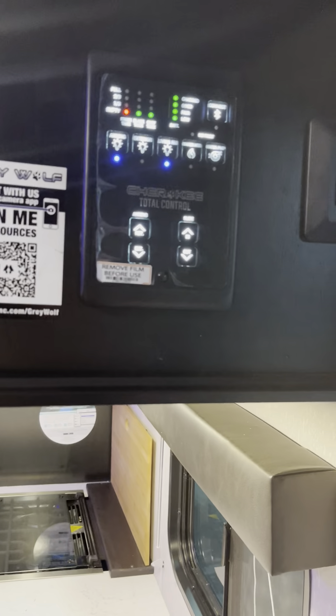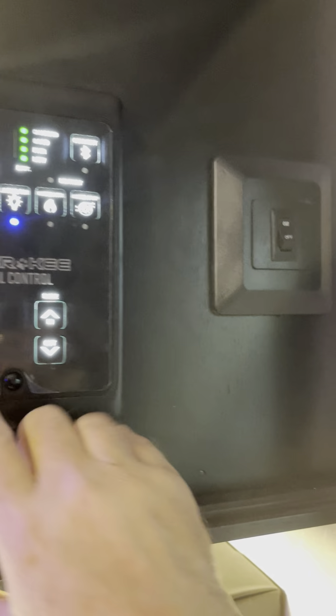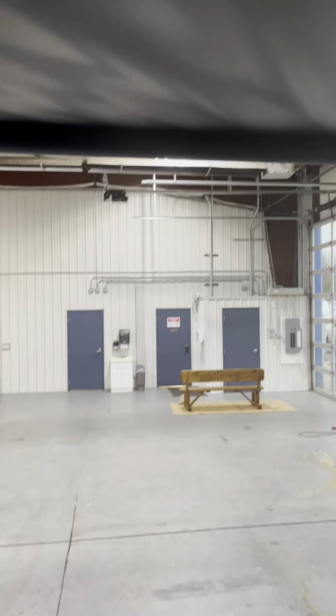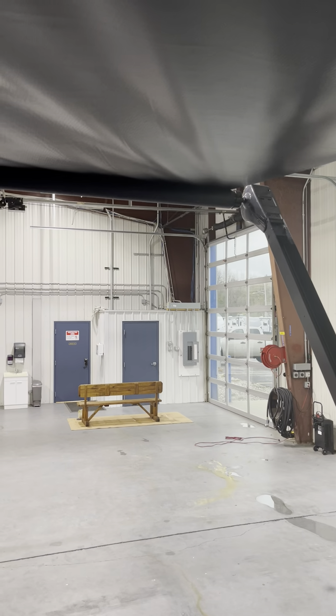Here's your water pump. Once you fill your fresh water tank, turn the pump on — it's not going to actually run until you lose pressure, like when you flush the toilet or use the shower. At that point the pump will run for a minute, and once the pressure gets back up and you stop using water, the pump shuts off. This button controls the powered awning in and out. If you get heavy winds or rain, put it away — heavy wind to me is anything over 10 miles an hour. Otherwise you're welcome to stake it down from the corner.